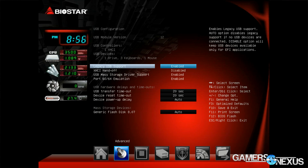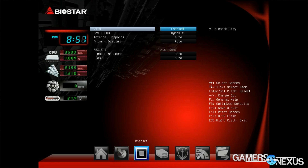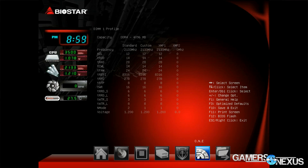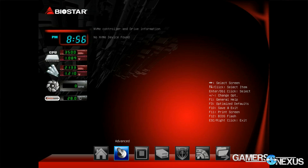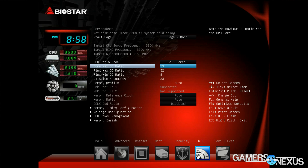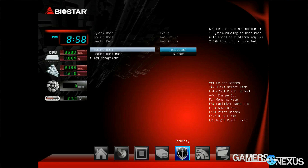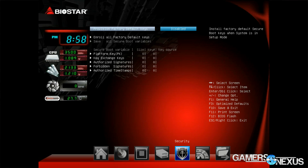UEFI options are fairly bare-bones compared to a Z170 chipset, which is somewhat expected. That's particularly noticeable with the locked overclocking functionality. Biostar has a ONE menu — O-N-E as they call it — that allows CPU multiplier upticking to the turbo clock, so users can force an always-active turbo boost setting, but no further overclocking is permitted. So if your CPU turbo is 3.9 GHz, it will allow a multiplier of 39, even though the reference base multiplier might be 32 or 34. This is a limitation of the chipset. Overvolting is available should the forced turbo require a voltage increase, and this extends to DRAM overvolting as well. CPU C-states can be disabled or enabled, and the power limiters can be lightly tuned through the ONE menu.